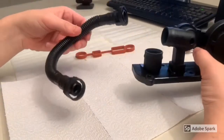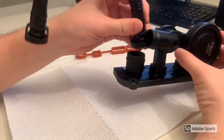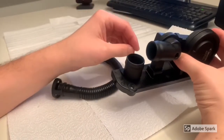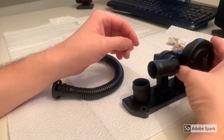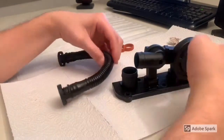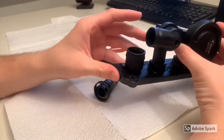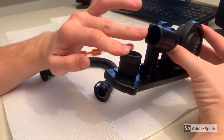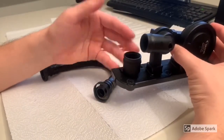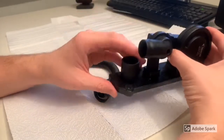Some people do a complete delete by removing both ports entirely, but that means all gases vent to the atmosphere, which is not recommended. The PCV delete kit instead removes the PCV valve and links the two internal ports together, emulating what happens inside the stock PCV when the engine is on boost — but without any fragile components to break or split. This completely isolates the inlet manifold from the cam cover.